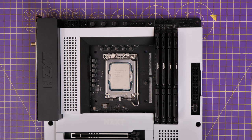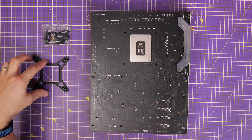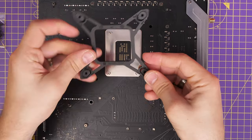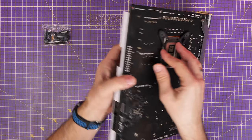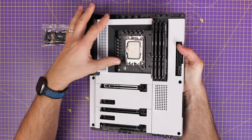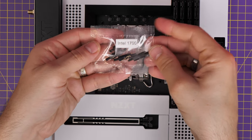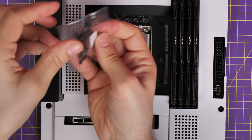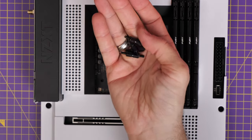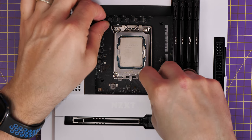I had problems installing four sticks of RAM here, so it's worth keeping in mind that some motherboards have issues with four sticks of DDR5. XMP can cause issues and even booting might be problematic — if you have an issue, just remove two sticks, but make sure you populate A2 and B2 first. Next we prepare the cooler setup — we have the back plate for the LGA 1700 socket, pushing the notches to the corners so they poke through. Then install the LGA 1700 standoffs included with the Kraken Z73.